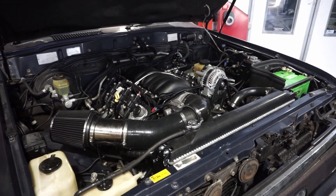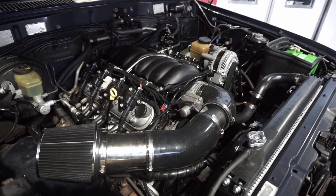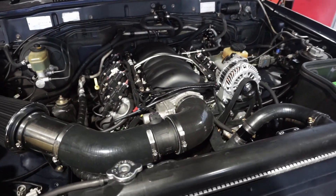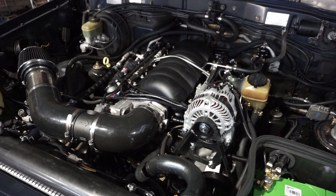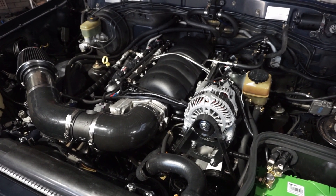All the wiring is done now and we've made up an intake for it. We've also sent it down the road and got the air-con hoses made. This is an LS3 6.2-liter and we fitted a VCM 532 cam kit, so it'll be interesting to see how much power it makes against the standard L98 with the same 6L80 combo. Let's fire it up and have a listen.